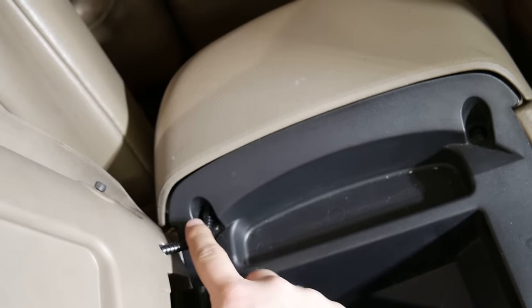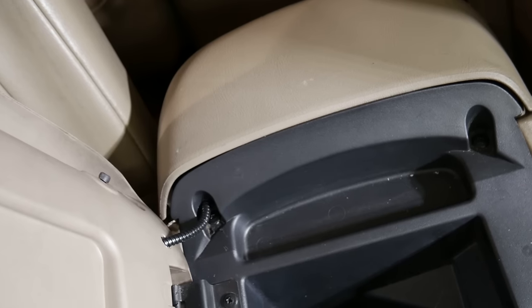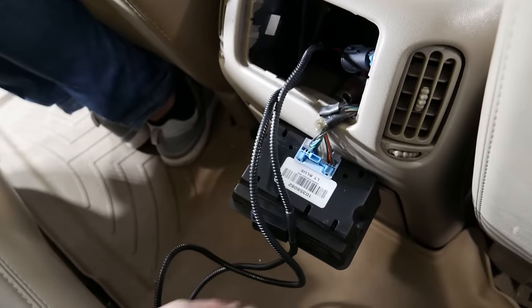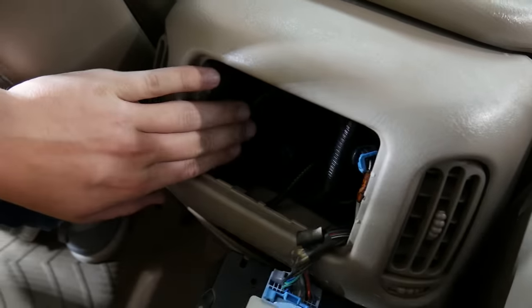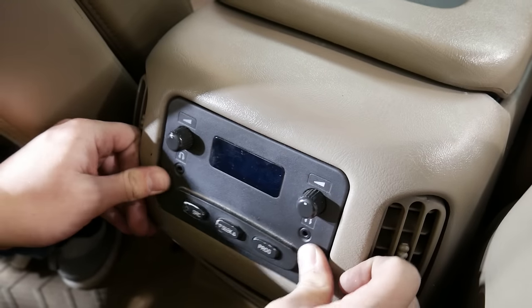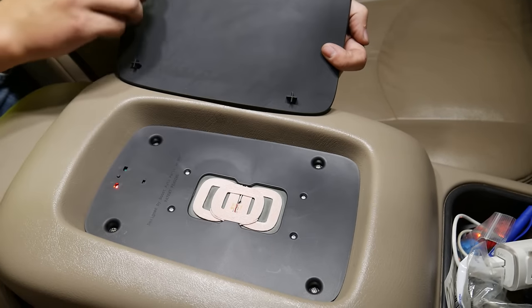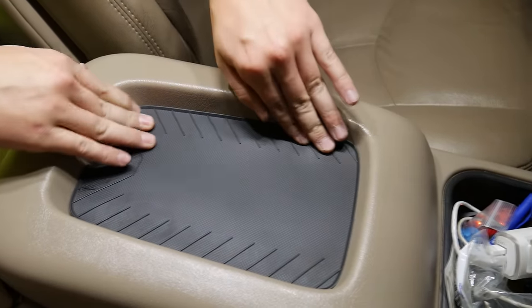Make sure that you have enough slack in the harness — pull a little bit in. Once you tuck everything in it'll sit okay, but you don't want it super tight. Do not use zip ties anywhere on the harness; you want a little bit of movement so the console can open and close. Take the extra slack and tuck it back out of the way. Put whatever was here back in — it'll just snap into place. Then place the rubber mat down: the little legs go into the four screw holes, press the four corners so it grabs.